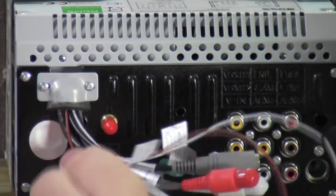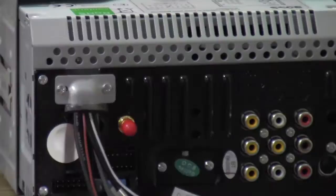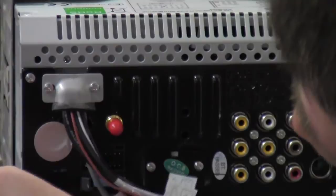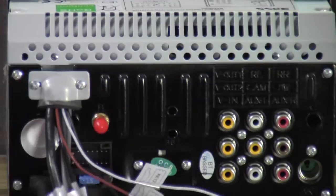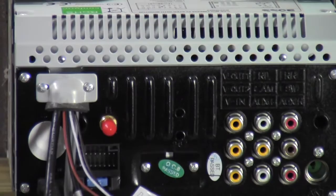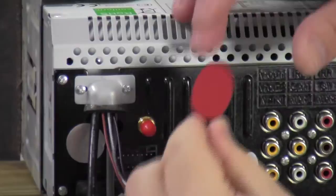This plug-in here is where the iPod cable goes in. The wires are in the way, making it a little hard to see where you're plugging everything in. So your USB cord plugs into that, and you'll have your microphone plugged into the gray port. This is your Bluetooth mic — it has a little sticky pad so you can peel it off and stick it somewhere. Make sure wherever you stick it, you clean it down with a good alcohol wipe so it has a chance to stick.